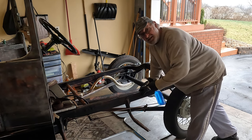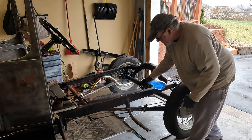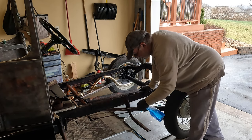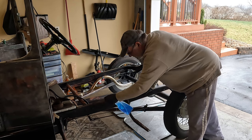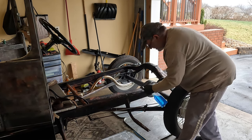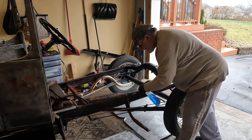We're at the second step in the three-step process. We're going to apply the KBS Blast. Just like the KBS Clean, we want a nice, liberal coating all the way across what we're treating. This is what's going to etch the metal — we don't want to let it dry. It creates a phosphate coating similar to an etching primer, which is what allows the final finish to stick to the frame.